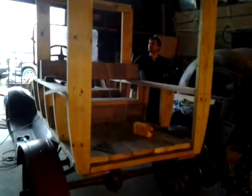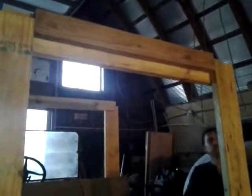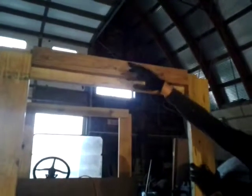We didn't put the floor down yet. We're going to have to do that. We're going to take some of this apart still, but we got this cross beam up here together, 2x6 and 4 for the doors. These will need to be trimmed. This has to go from center down to a curve to the end here. So we'll have to take some off of that.